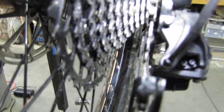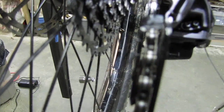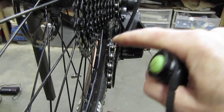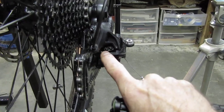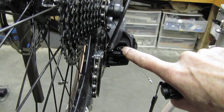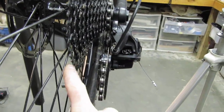Here's that little screw I tightened. Looking at the top pulley — it's not too close to the gear, though I won't know for sure until I get it out riding. While we're at it: these two screws adjust the limit on how far the derailleur can travel each way. To stop the derailleur from coming too far inward, use the inner screw; to stop it going too far outward, use the outer screw. With no cable on the bike, pull the derailleur in and set this straight line, push it the other way and set this straight line — you'll be pretty close.